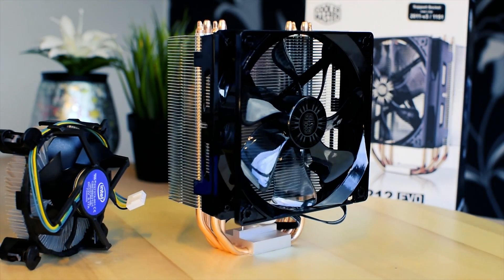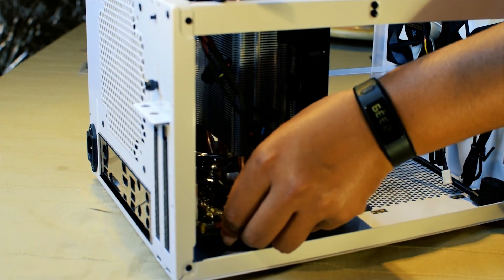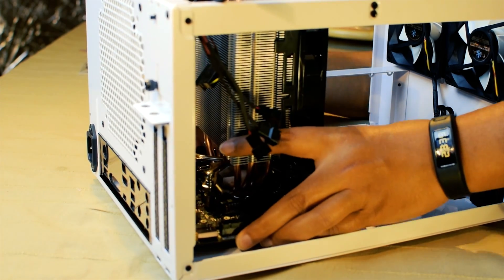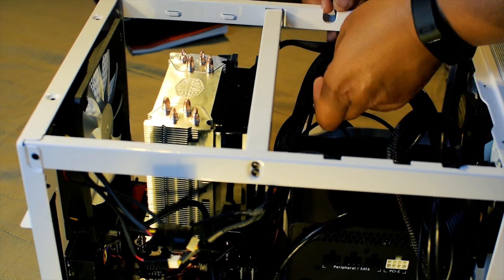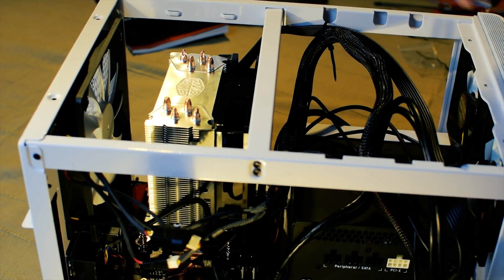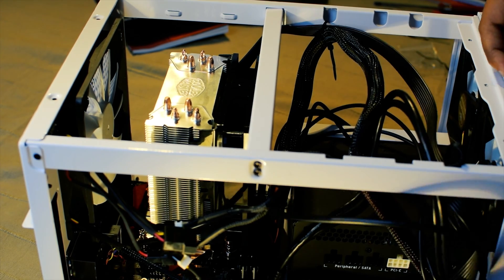This case can support tower CPU coolers like the Cooler Master 212 EVO or any other tower cooler which is less than 165mm — again, check out my review of the same. This case requires more cable management than a typical ATX case, but Fractal Design has tried to help by providing notches for the same.